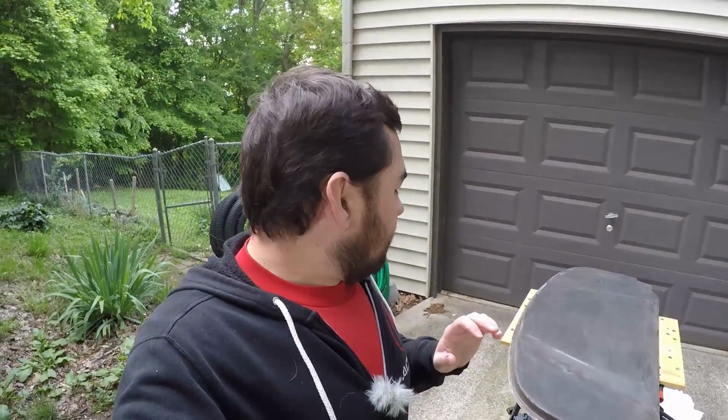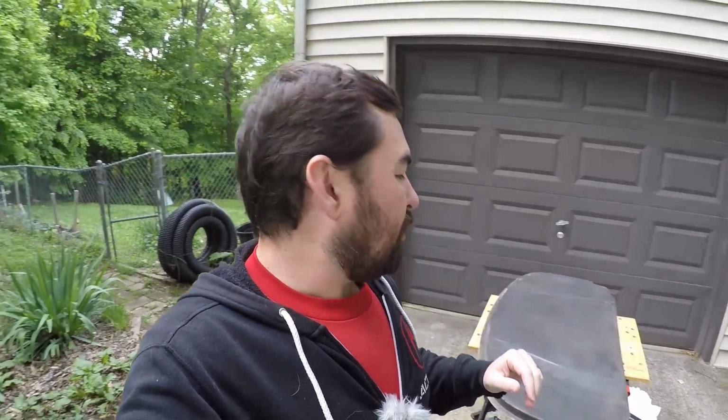It is another day. This has had a chance to dry out, and then in the meantime, I've also gone over it with some 220 grit sandpaper just to knock down the rest of the glue residue that was left after the pressure washing. Now, that's left a bit of an imperfect surface here, and that's okay because I'm not trying to paint it. I'm just trying to get it to a gluable surface. And honestly, having a little bit of a rough texture from 220, I think will probably help the adhesion, whereas you would want to go much finer than that if you were going to paint it or do some other kind of applied coating that wasn't just a fabric over the top.